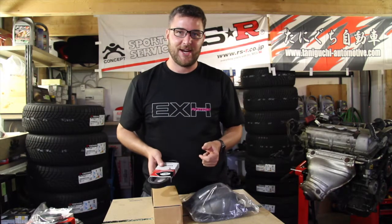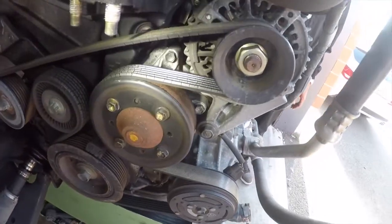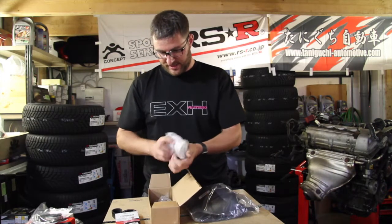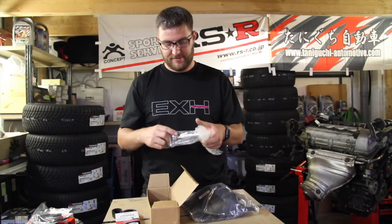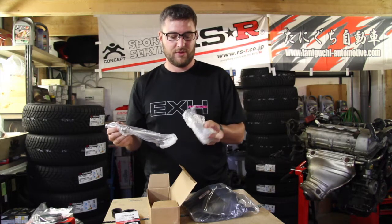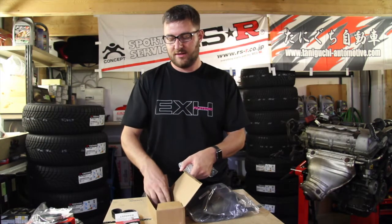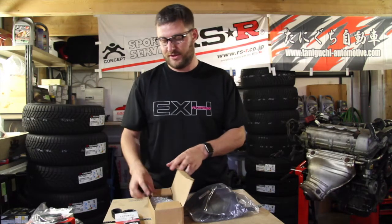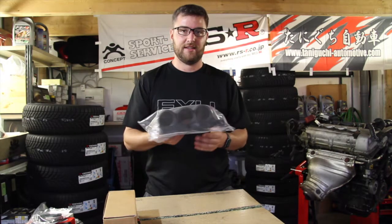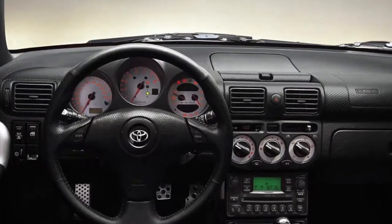Finally, a few extra things I'm planning to add. I've gotten a brand new accessory belt — as you can see, the old one is totally destroyed. One thing I really didn't like in my MR2 is the sloppy shift feel, so I've gotten a Monkey Wrench Racing short shifter kit with all rigid bushings to improve the shift feel. Especially with the six-speed gearbox, going from five to six gears, it's really important to have no missed shifts.